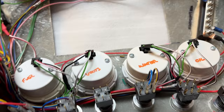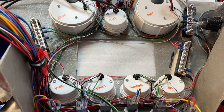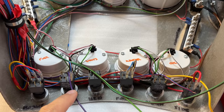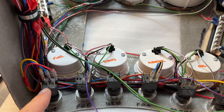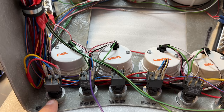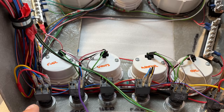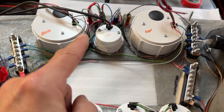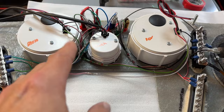Blue-orange is now the fog, plus using the violet as well — which goes here and is jumperd so it also illuminates the fog switch when turned on. Blue-red needs to move. I'm just short of a couple of terminals, but fog light wires and hazard light wires are laid out. Some jumpers need feeding all the way back to the indicators. And on the handbrake — I was massively overthinking it. The savage handbrake switch will have separate illumination when side lights are on.